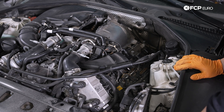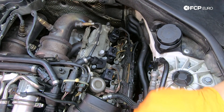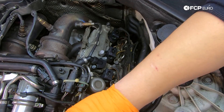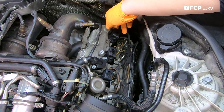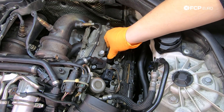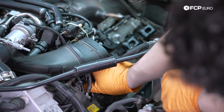From here I like to disconnect all my ignition coils and then start popping them out one by one. At this point we can access all four ignition coils. The most forward one is a little buried under the intake tube that feeds to the turbo, however it is definitely accessible. You can go the extra mile and remove some of the piping up here, but we'll be able to fish it out no problem. Start by lifting up on the ignition coil cover here to unclip the latch — the connectors will pop out with it. The one up front is facing the other direction.